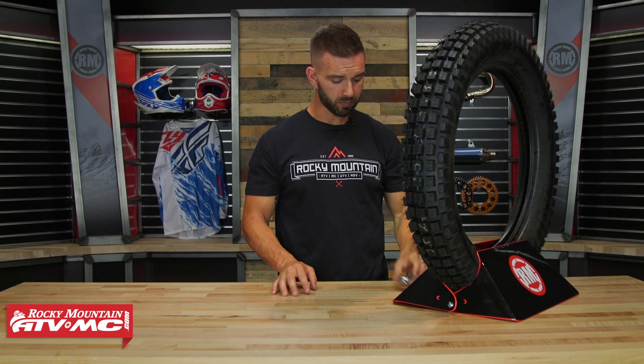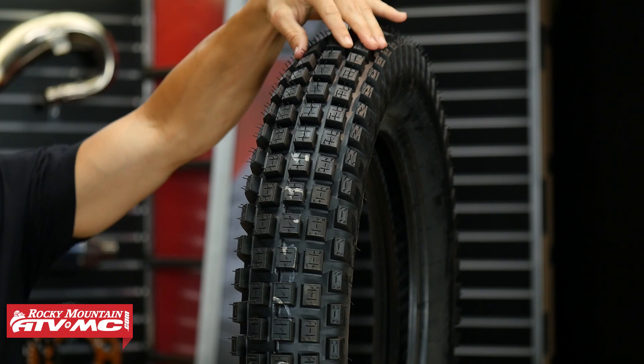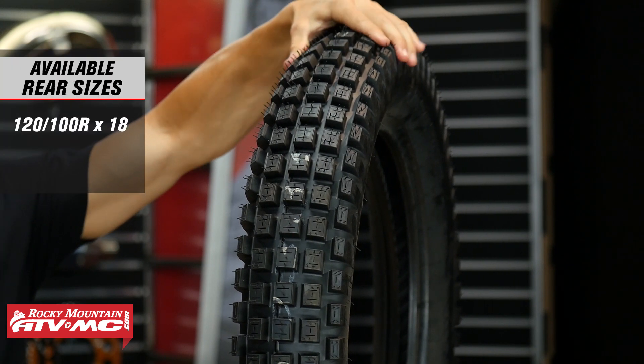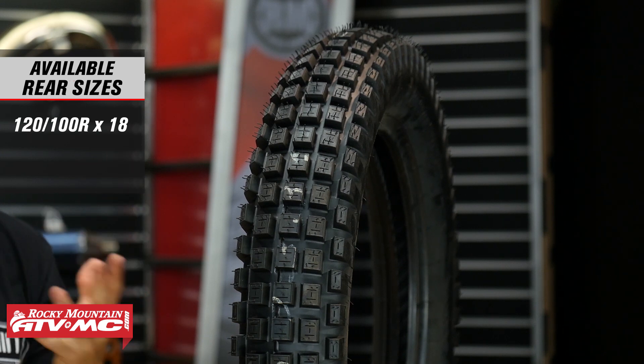Now interestingly, we actually measured the hardness of all the rubber compounds of all the tires that I'm going to show you today. So I have my durometer here — the Dunlop was just over 50, which is a very soft rubber compound. To give you something to compare that to, a traditional intermediate knobby tire is going to be anywhere from 65 to 75, or even harder. So it's a very soft rubber compound, and when I grab these knobs, you can see they're flexible, but they're almost sticky. You can feel the stickiness on that rubber, which means these things hook up absolutely awesome.